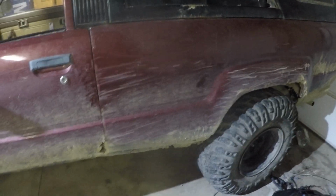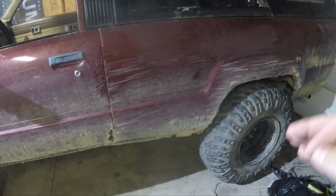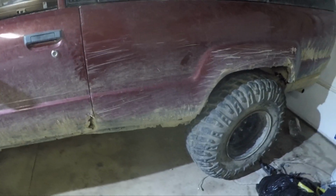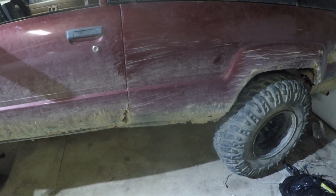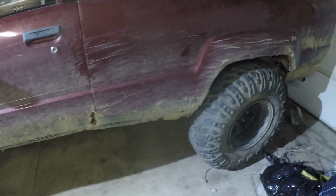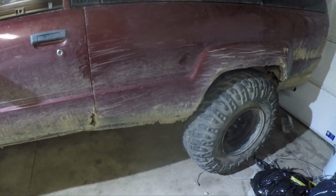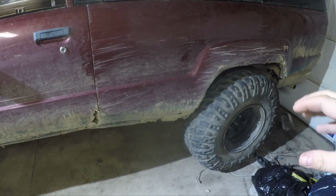There is a rear locker in the axle now. Or I should say there is a locker in the rear axle now. Something in that whole system is broken and messed up. So I bought the locker used from a buddy. It's still the factory 410 gears, just with a lunchbox style locker put in it. For some reason, it's not disengaging. It's not ratcheting like it's supposed to. It's just staying locked like a welded diff. So that's broken.